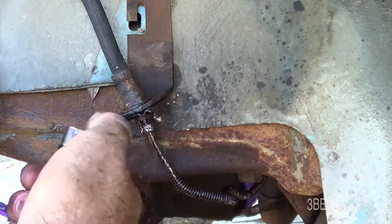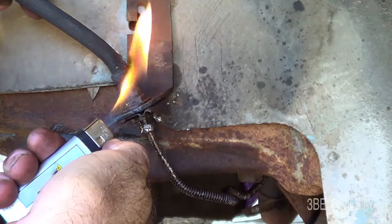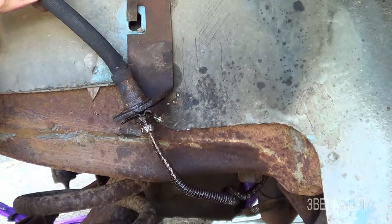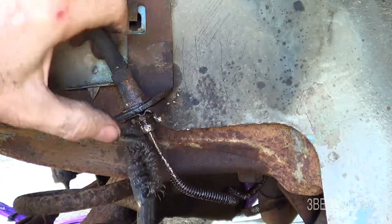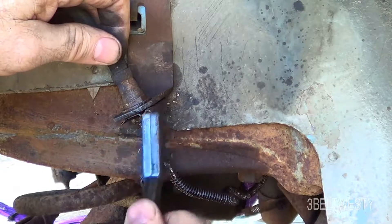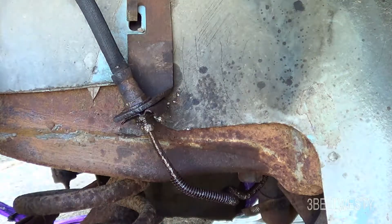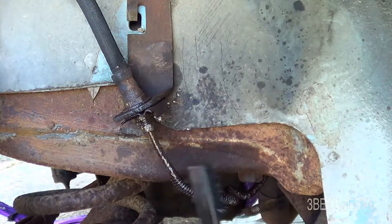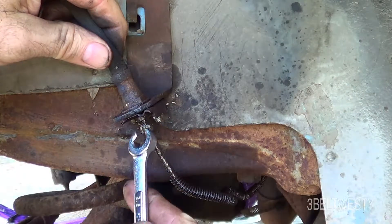This is the stubborn left side — I'll replace this hose anyway. I've been trying — I've heated this thing up to where you can't touch it, and I've also gone through and frozen it trying to get this joint out. I still can't get that out. I've been tapping on it, using a wire brush. Gone up under here with a pen knife and got around the threads, used several different wire brushes, and I can't get that out. Looks like I'll be replacing this brake line. The nut is really destroyed — I can't get any grip on it even with the flare wrench. It's starting to round off and I've been messing with this for a week.